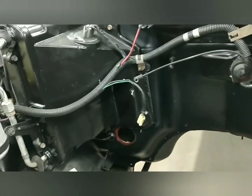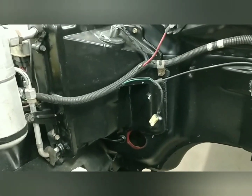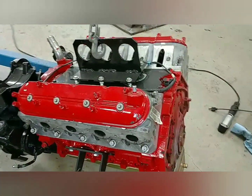The other deal is I thought I could get away without having to do this air box deal. You can see here where it's been cut — I had to do all that and then refiberglass it back in. Originally it came just straight across. I thought that if I had the coils not mounted to the valve covers I could get away without doing that, but in order to slide the motor back as far as I could to make it so the transfer case and all that would be lined up — so I wouldn't have to modify the drop shafts — I ended up having to cut that. I'm still not going to put the coils back on top of the valve covers because they just look a whole lot better without them. I painted them up and might cut some aluminum plates to go over it on the CNC and make them pretty.